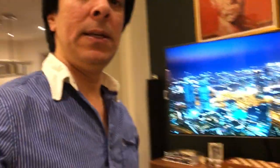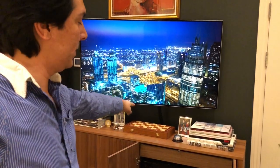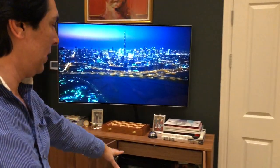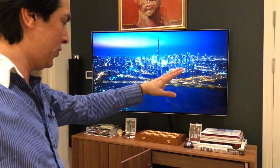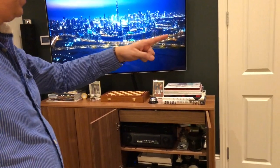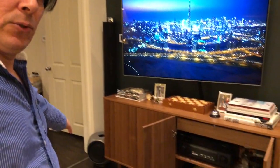The TV has an optical fiber cable going into the amplifier. Instead of using the amplifier's powered source, I'm using the preamp — so it does the sound processing without going through the amplification, because all the speakers have built-in amplifiers and don't need it. Each channel is then fed into the transmitter, and you get full surround sound and crystal clear high-definition music. It's just breathtaking — I don't even want to leave the house anymore.